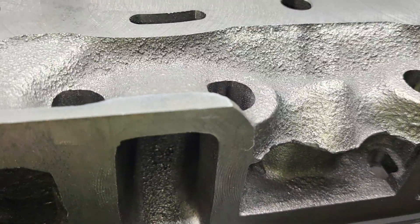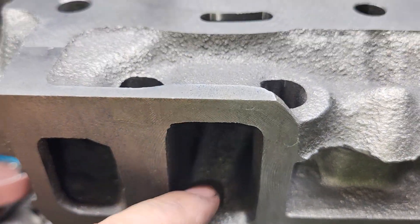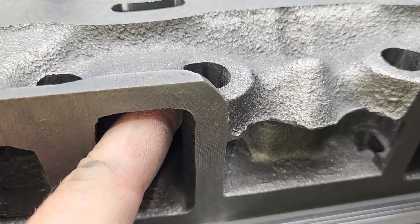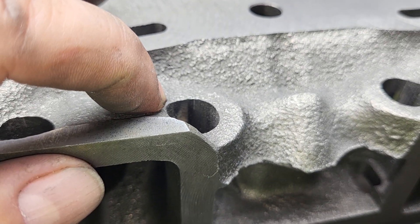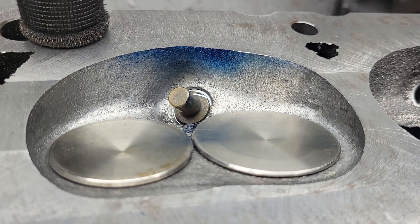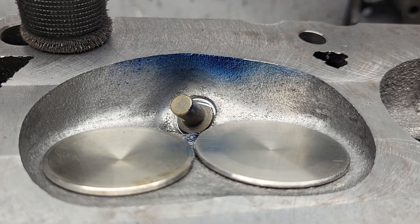Now one of the first things I want you to know about is this pushrod hole. This one is less than a hundred thousandths before it's touched. So you've got to be careful. I mean, obviously it's made to put tubes in. The customer didn't specify that, but I'm sure he'll be seeing these so he can let me know. But as of right now, the pinch is not a problem.